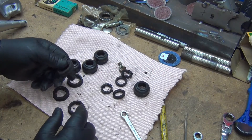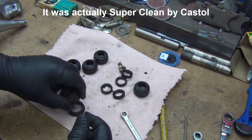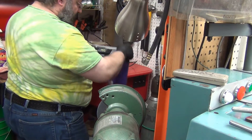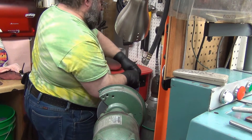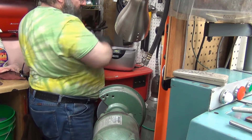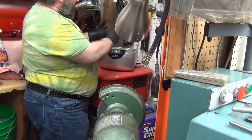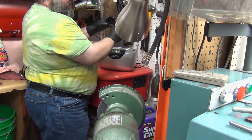These are the lower control arms. What I'm going to try doing is put Purple Power in the ultrasonic cleaner and see how that works. It says wear rubber gloves. I hope that's what the parts look like when we're done. The ultrasonic cleaner works off cavitation — it runs at ultrasonic frequencies that create little tiny bubbles that explode on the surface, and that's the scrubbing action.